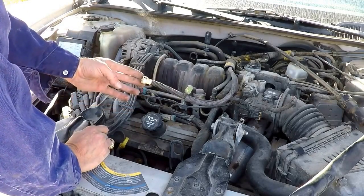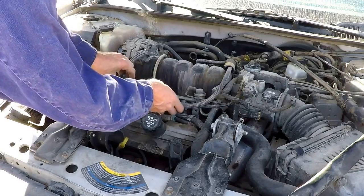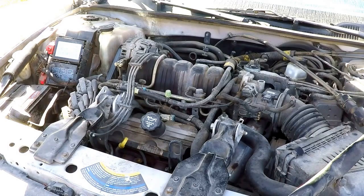We're going to try to find the connector from the dealer or an aftermarket source to hook this back up permanently. In the short run we're going to hook it back up and hope it latches, then reset the code and give it a test drive over the next few days or weeks to make sure it doesn't come back on. Ultimately we do need to fix that connector, or at some point the same thing is going to happen again.